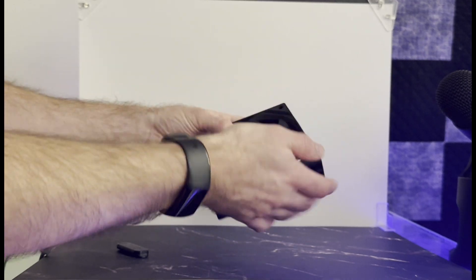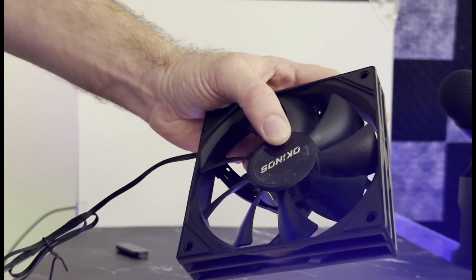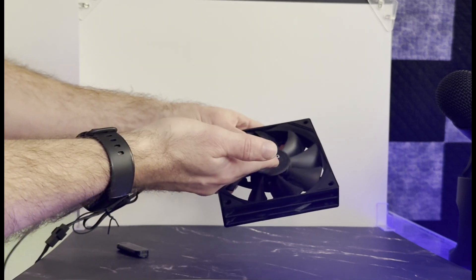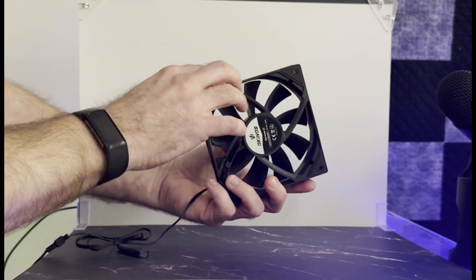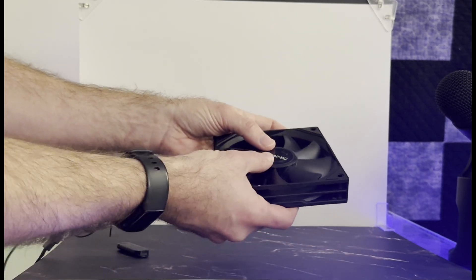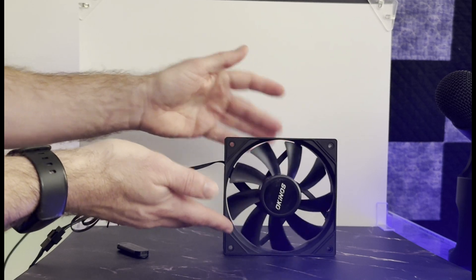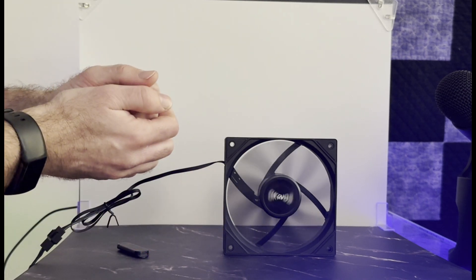The struts have a little bit of shape to them, so they're not completely flat. There is dust that's built up on this, and it's been used very minimally in testing — it could be oils from fingers or just natural build-up. This is the only fan I have that's had this problem; my Noctuas don't. So it may be more prone to dust. Either be careful not to touch it, or it may require extra cleaning. Overall it's just a very basic fan, and assuming it does well in value, it could be a great budget pick for budget-conscious computer builds.